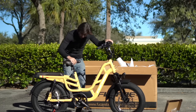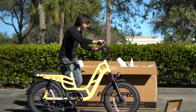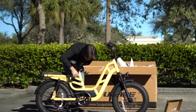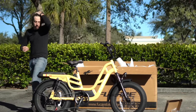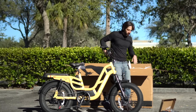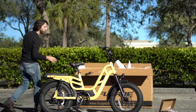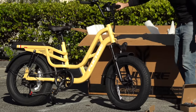Let's do a quick check — derailleur, axle nuts front and rear, fender clearance, brake check front and rear, suspension. Does have lockout? No, it doesn't even have lockout — so a cheaper suspension fork. Pedals tight, crank is clear, no play in the headset. This is a full suspension fat tire bike with urban tires that have enough tread for light dirt trails. We have spoked wheels and mechanical disc brakes — not hydraulics — but they feel nicely tuned out of the box.